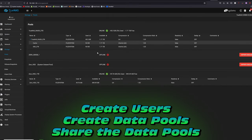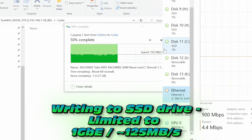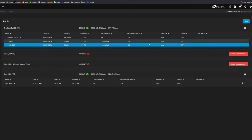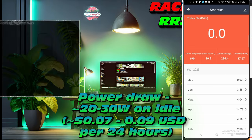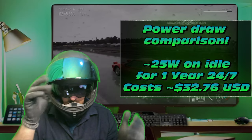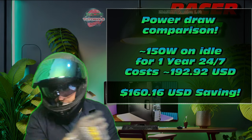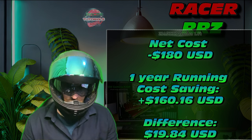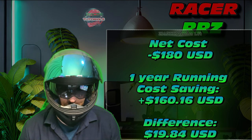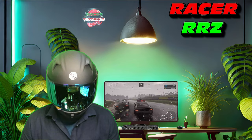In terms of the setup, if you want a full TrueNAS guide there are thousands of resources available. As proof of concept, we're getting around 100 megabytes per second — basically saturating the one-gigabit port. Power draw is around 20 watts, which is pretty reasonable. And that's it — we now have an incredible home NAS you can use for almost any purpose, just by digging out that machine from the back of your closet. Like, comment, subscribe — catch you on the next video.